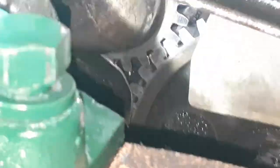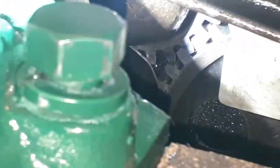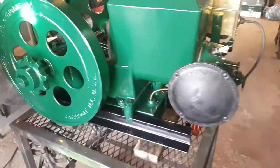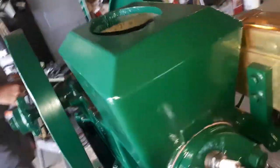Somebody at some point in time made two marks on the cam on two different teeth. Right there. Okay, stop. You see them? Yep. Mark there, mark there. I know my finger is way out of proportion, but those two marks, somebody had marked that, and that's what we followed. We never saw the other two marks, so this thing was basically firing 180 degrees out. Almost. Maybe a little earlier than 180.